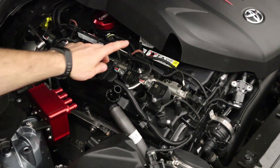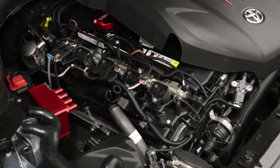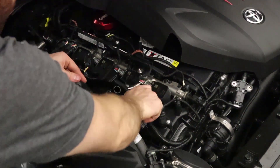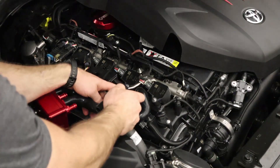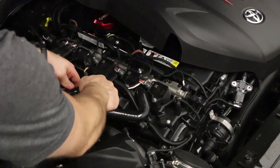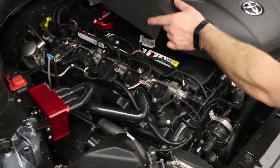With the AOS installed, we're going to install the silicone hoses. There is an order in which they go on — install the long one first, as that makes it easier. Then the second hose goes on, and I recommend going on there first and then snaking it over the top and on. The final part of the install is to place the cover back on.